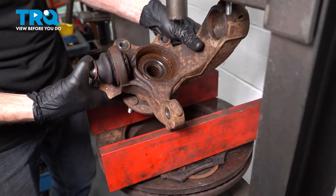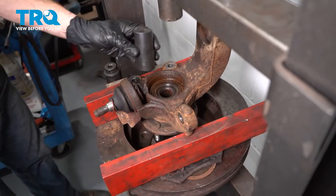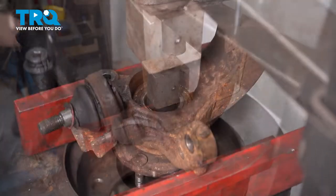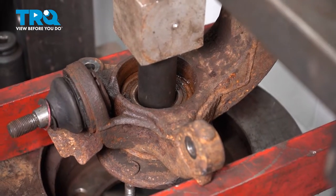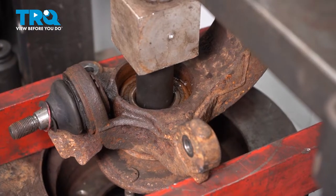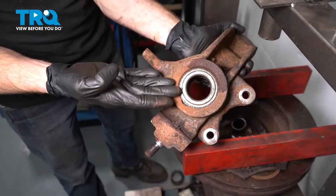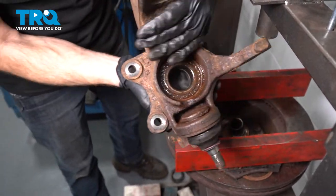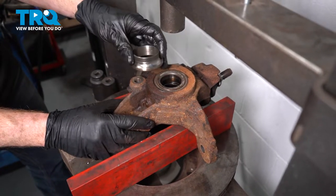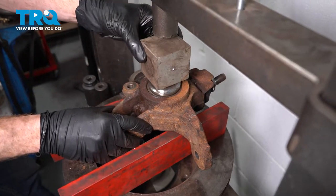The next thing we need to do is press the hub out of the wheel bearing. To do this, you're going to want to be on a bearing press. Let's get this lined up as evenly as possible so it's parallel with the ground. The next thing you want to do is use a spacer that goes directly over the hub but does not hit the bearing. Continue on taking up a little bit more space and now we can start pressing this down. Now that we have the hub out of there, the next thing that you want to do is start pressing the bearing out from the front out through the rear. With the knuckle facing so the outboard side is facing up, we can start pressing the bearing down and out. We'll use a spacer that fits directly over the bearing itself but does not hit up against the knuckle. Now we'll continue on with a spacer and then we can start pressing this down.